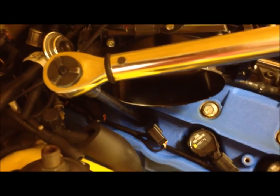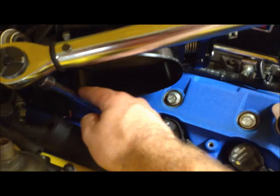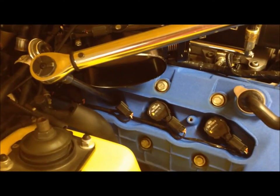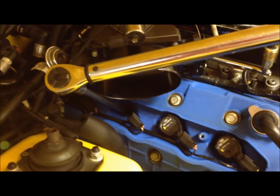My extensions are barely touching the throttle body and it's a pretty good straight shot — it looks like it's going in very straight. Since I've threaded it down all the way I already know I'm not cross-threading it, and I'm just paying attention to make sure there's no torque variation since I'm up against the throttle body. You can take the throttle body off if you want, but on some applications where you can't get down there, this is what you pretty much have to do.